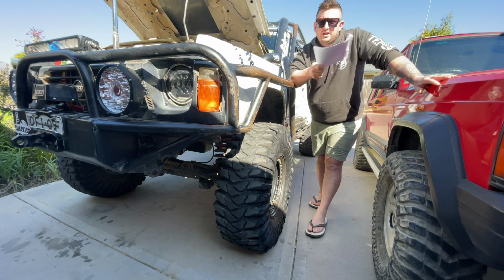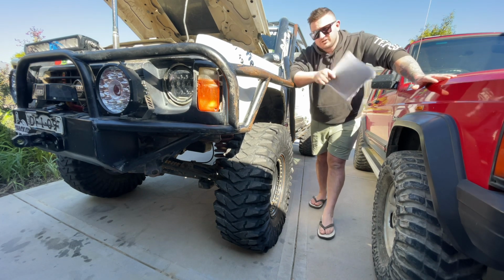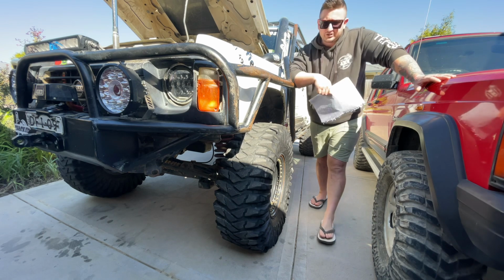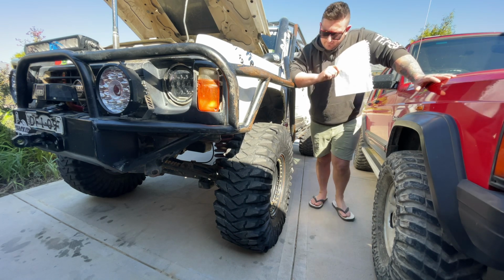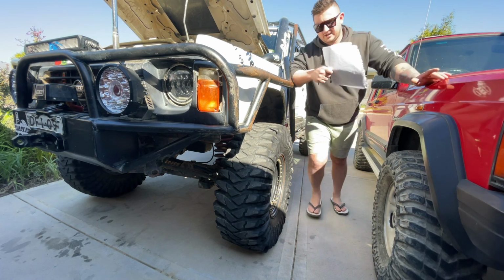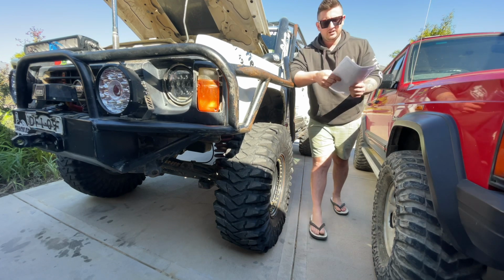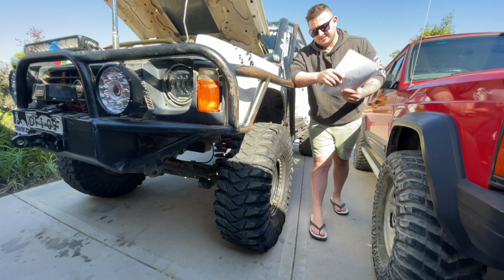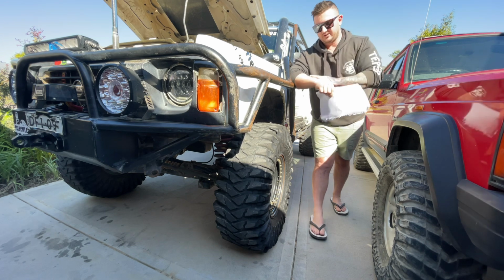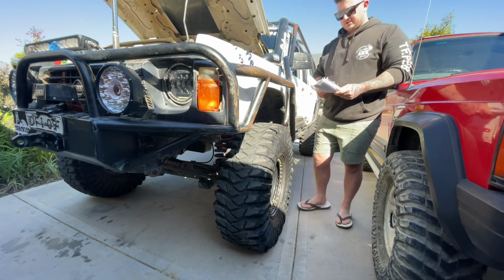Mike at No Bull Beresfield, Pedders suspension, hooked us up with 4-inch coils and 6-inch 80 series shocks. They're 12.5-inch travel shocks, and yeah, 4-inch coils. I've got a 2-inch body lift as well that was previously already fitted to the car. Obviously, when I bought the car, this car had a few extras already on it. So the body lift is actually going to be removed soon. I just want it a little bit lower. I want to stick it low, wide, and locked.